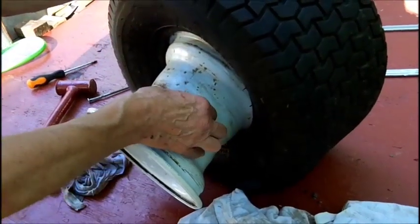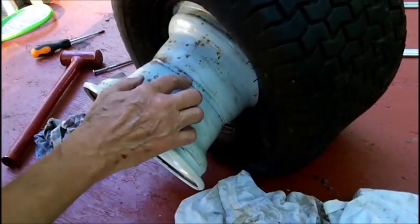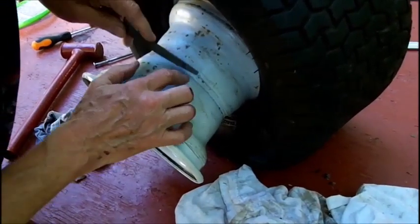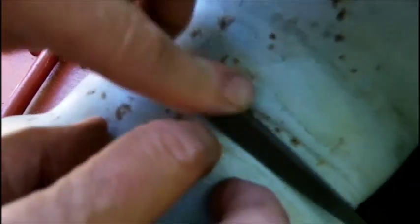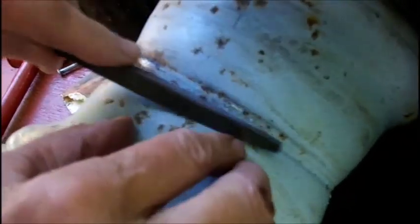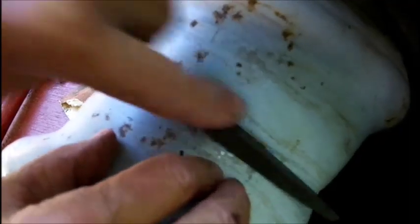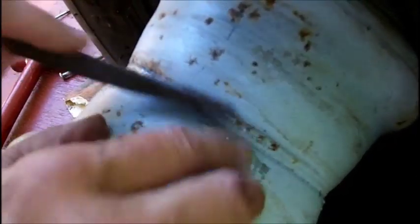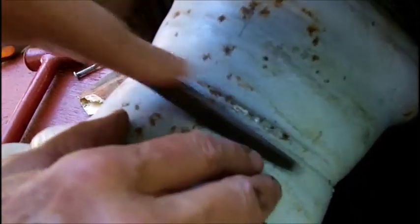Here's what I learned from one of the channels I watched on tires - there's what they call welding slag right here, because these rims are welded together. There's a little piece right there. I just want to file that out, because my garage is not going to do that. The tube will get a worn spot in it and it'll puncture.